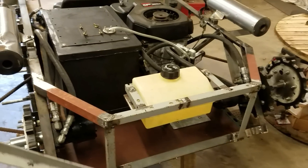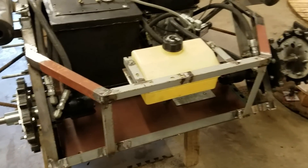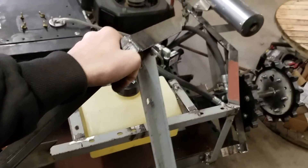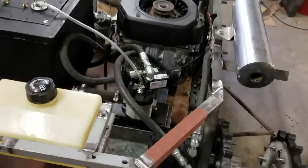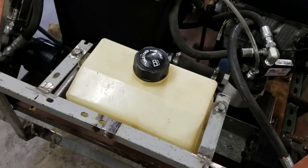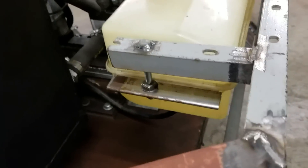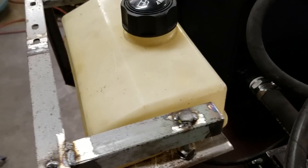I've been looking at the back profile of this for the longest time thinking about how I'd change it, so I finally got that done and I'm really happy with it. I also changed some pieces of the gas tank — it's back here now instead of up there, because when I cut the frame I had to remove one of the supports for the gas tank. Since I had a whole bunch of room back here after I changed the setup, I decided to put the gas tank back here. It's pretty simple — just a couple pieces of angle iron coming out, and it's set down on a couple bolts attached to the flange of the gas tank. I think that's a much more convenient spot for it.